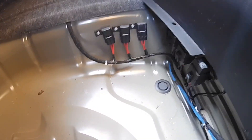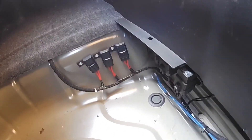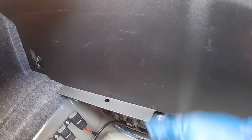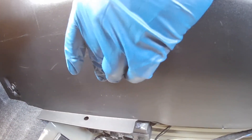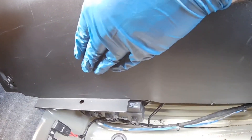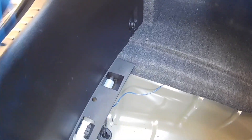Starting in the trunk — you can't really see much, it's all hidden pretty much. You've got your fuses and relays from the Lethal triple pump wiring harness. I got it off their website — makes everything way easier. Got it ran back here, and down that way there is a ground. Behind here the harness will ground over here; there's a bolt hole the same size. I went and bought a bolt from NAPA, matched it up, wire-wheeled it so it was bare metal, and grounded it through there — so I didn't have to lengthen anything or make new holes.